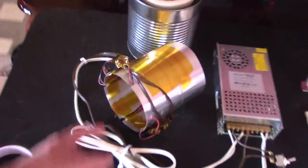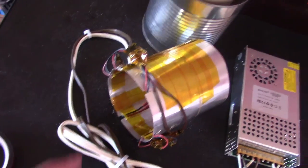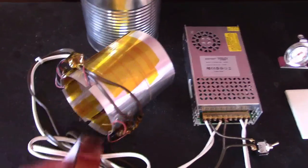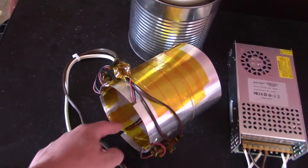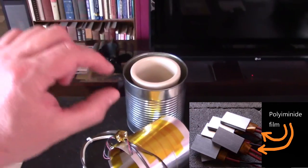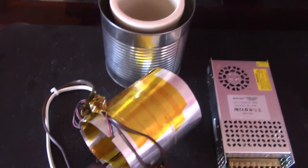By the way, the wires have a high heat-resistant coating on them, so they'll be totally fine against the metal. And the tape itself — this high-temperature tape — it's actually something called polyimide film with an adhesive. Believe it or not, they use polyimide film inside the heating elements: they wrap the ceramic stone in polyimide film, the same stuff minus the adhesive, and then they clamp down the aluminum shell, the thing that you can see. So that's why I knew this tape was going to work.